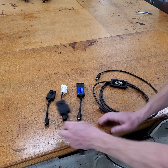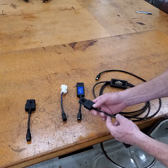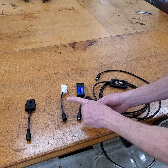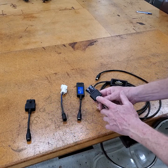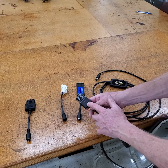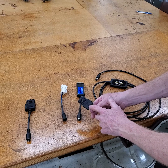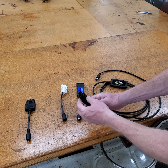The other cable that's very common is the newer Mercruiser cable. Part number 94006 is very close to 94005, so these were made almost at the same time. This cable came a little later and it's used on Mercruiser engines that have SmartCraft. If you have a SmartCraft system, you still need an adapter to plug into the engine.